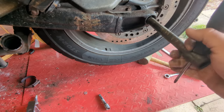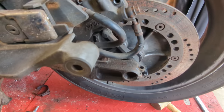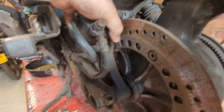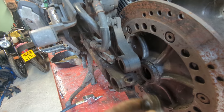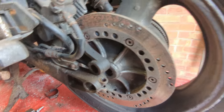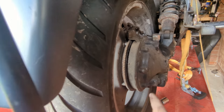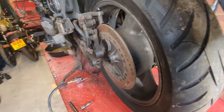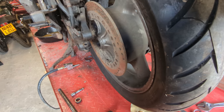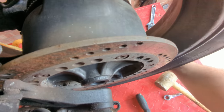That should mean it rolls forward, or actually goes nowhere, which is just as good. Then once you've got that out you can lift the brake arm out of the way, grab this spacer. That spacer gives the wheel the room it needs to go off of the driving unit to the left. And if my hammer wasn't there it would do just that, but I might need both hands for this - I kind of don't want to drop it.